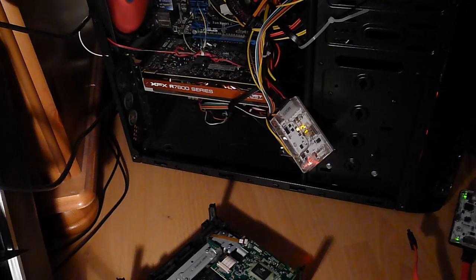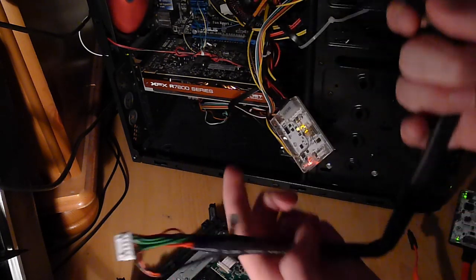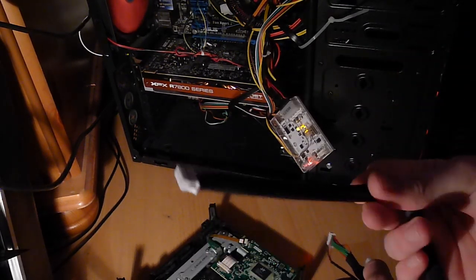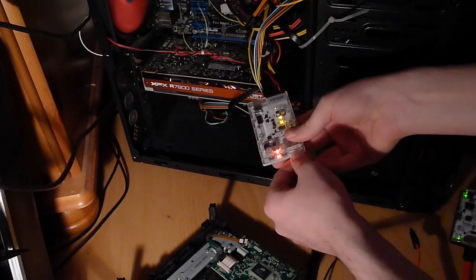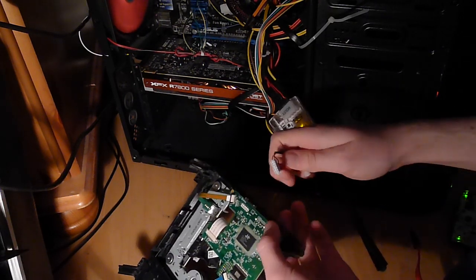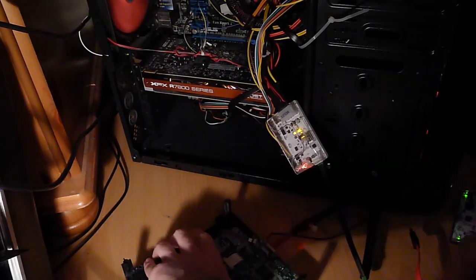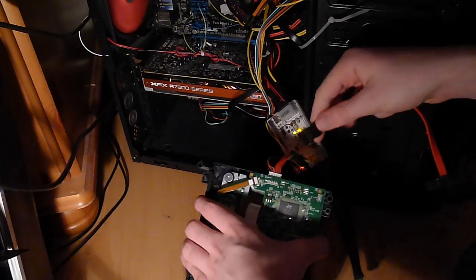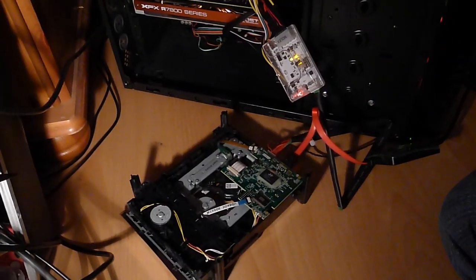What we've got to do here is get this cable hooked up. The point that has the button on it goes into the drive; the normal standard one goes into the CK3i. Now hook up the CK3i to the drive, and then the SATA port from your USB Pro or from your computer will go into the SATA port on the DVD drive. And that is you officially got everything hooked up and ready for flashing.